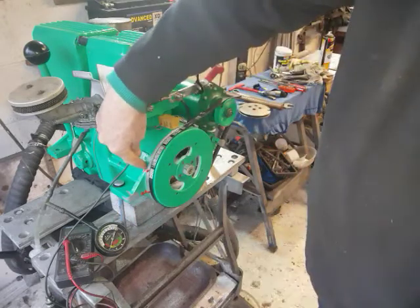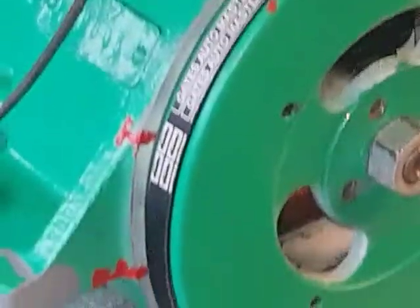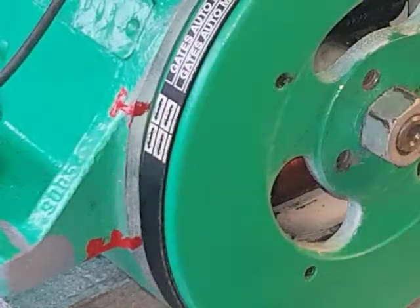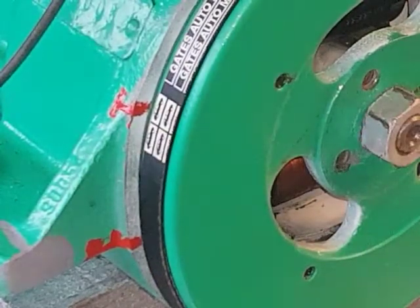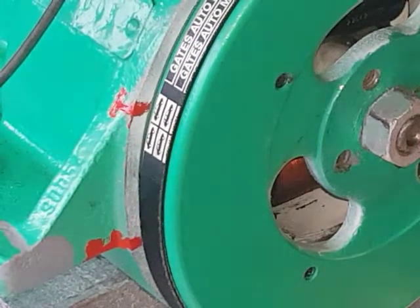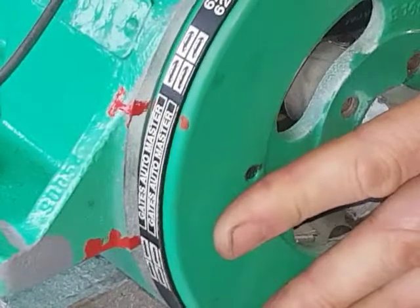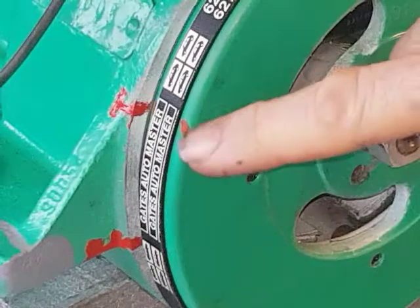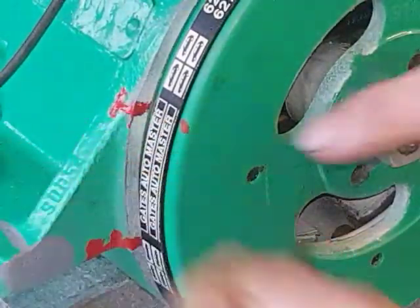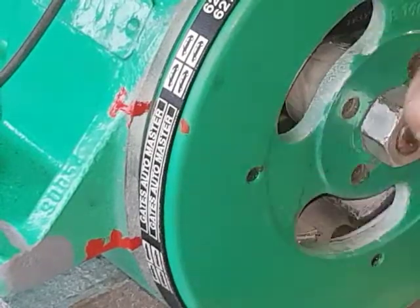Top dead center is a bit later. I've painted an F for firing and a T for top dead center on the flywheel. Just in case your flywheel slips, you may want to use a long screwdriver — make sure there's no dirt on the tip — and drop it down the spark plug hole. Jiggle the engine until the screwdriver is absolutely motionless at the top, and that verifies the dent you're looking for. You can then mark and paint that dent more clearly, and it also confirms there are no issues with the key being chewed up or the flywheel being at the wrong angle.